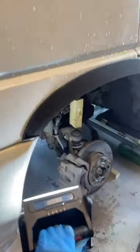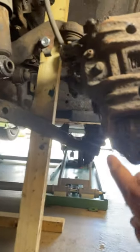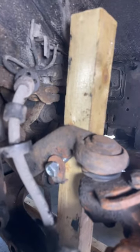If you've got a VW T4 and you're trying to change the drive shafts, it can be tricky because you've got to swing the bottom of this hub out and away when it's off its ball joint. But the top arm is pressing down because of the torsion bar suspension, so get yourself a weighted piece of wood with a big bolt through it.